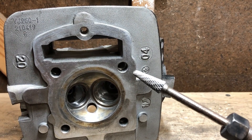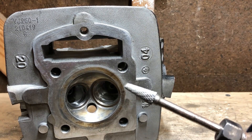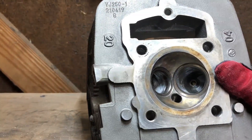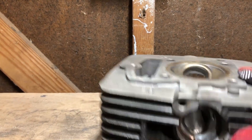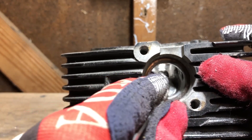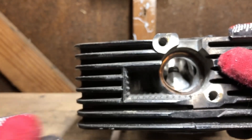To this point, most of the work has been done with a cone-shaped double-cut burr. Once you feel you've removed all the material you'd like to remove and the ports are adequately sized, you will have shaved down your valve guide boss — that protrusion right here. Some cylinder heads have a larger one than others, so you'll have to remove more material.